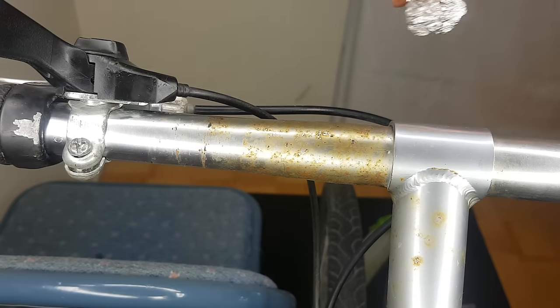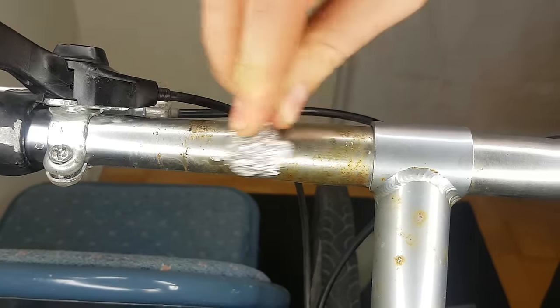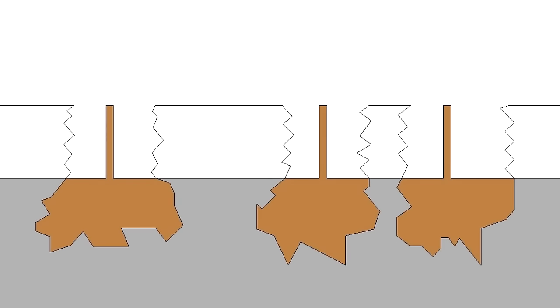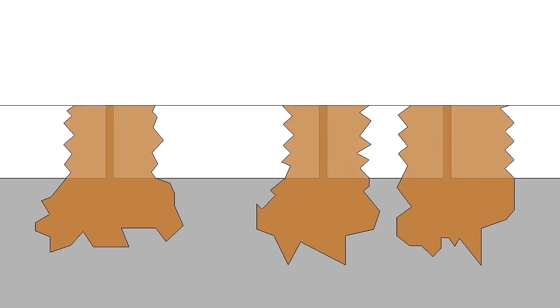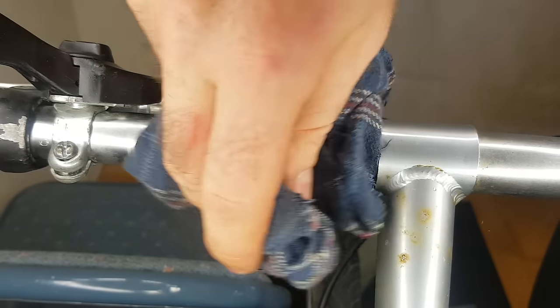But to get back to chromium plated parts — sometimes you'll encounter parts which are so badly rusted that when you try to rub them with aluminum foil you'll find that there are some spots which never go away. My theory is that the pores in the surface have gotten so badly rusted that craters have formed and small bits of chromium have flaked off, exposing the bare steel. Once the chromium is missing it's never going to be perfectly shiny like it was when it was new, but rubbing with the aluminum foil will still make it look a lot better.